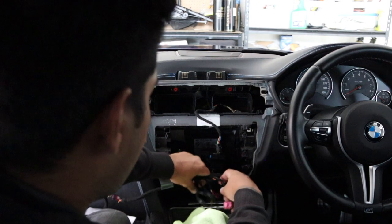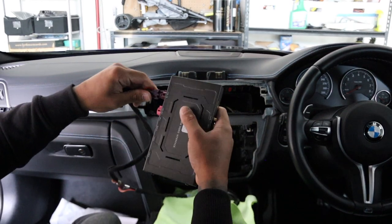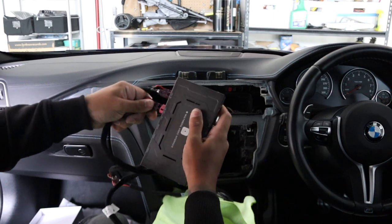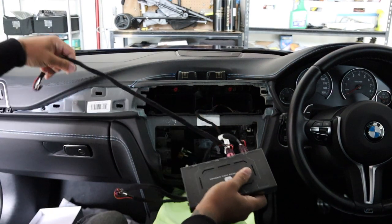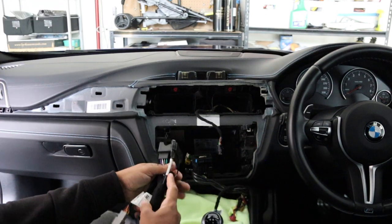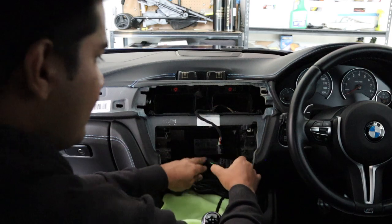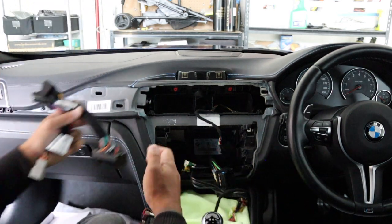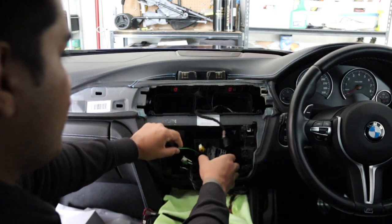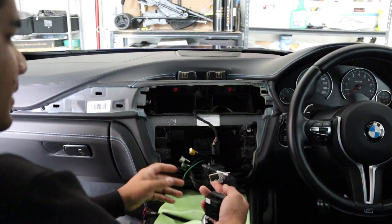You can put a bit of tape around that so you don't forget what's what — label it 'radio module.' On the module, that's going to go to LVDS in. LVDS out runs from your module up to the screen and plugs into the screen. Next up is the quad lock connector — pretty much plug and play, it will only go one way. You need to remove the fiber optic connection from here, cut some of the tape, remove it, and then put it into the same position — top left on the new plug — to give a little more room.